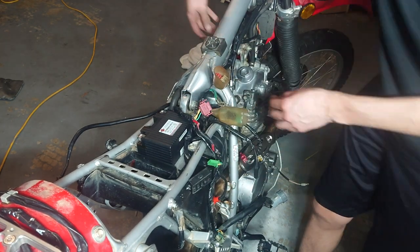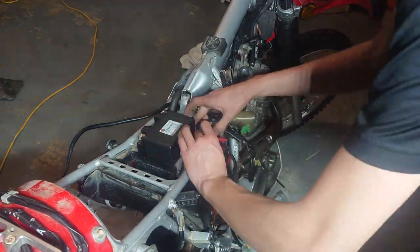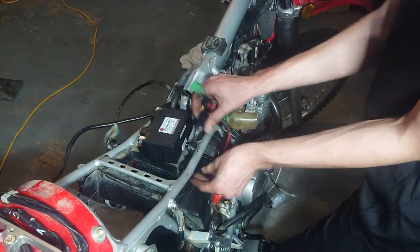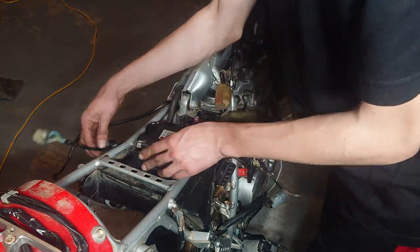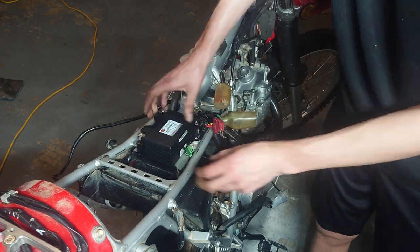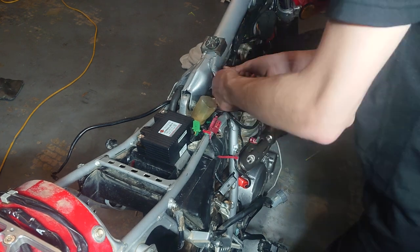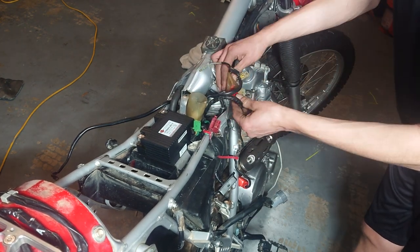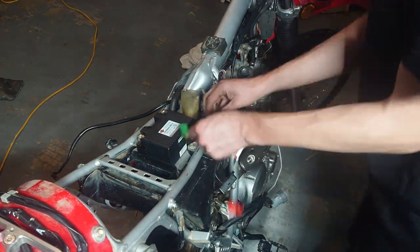How you reroute the wires is totally up to you, but a few pointers: definitely put the ignition to the right of the shock absorber, and put the fuse box kind of below the frame. You may have to remove the fuses like I did but it will help tremendously. I mounted the fuse box with zip ties afterwards. I still had a CDI to place, so I went ahead and put it inside the airbox and mounted it with a zip tie — you don't have to, but I chose to for extra security. Those are just a few pointers I really would have liked to hear beforehand.